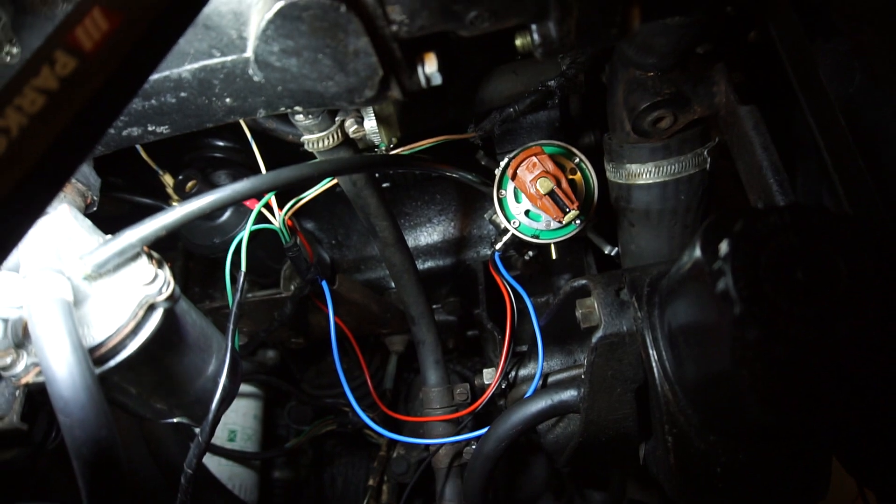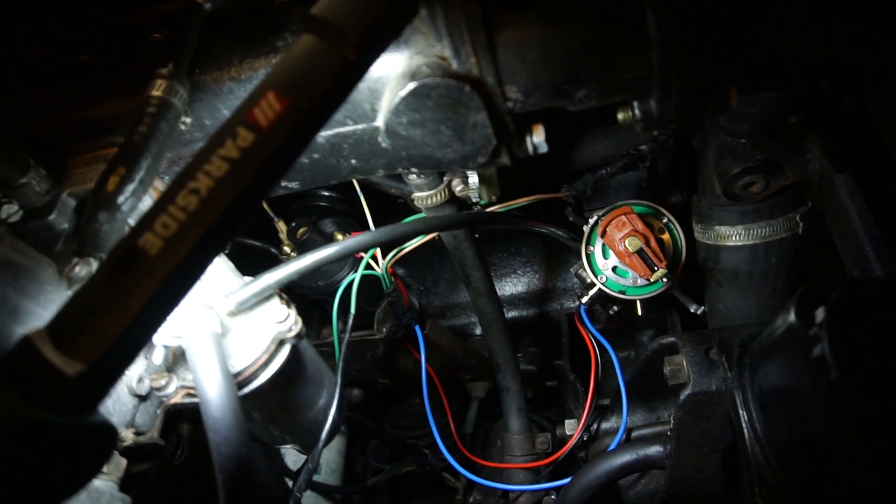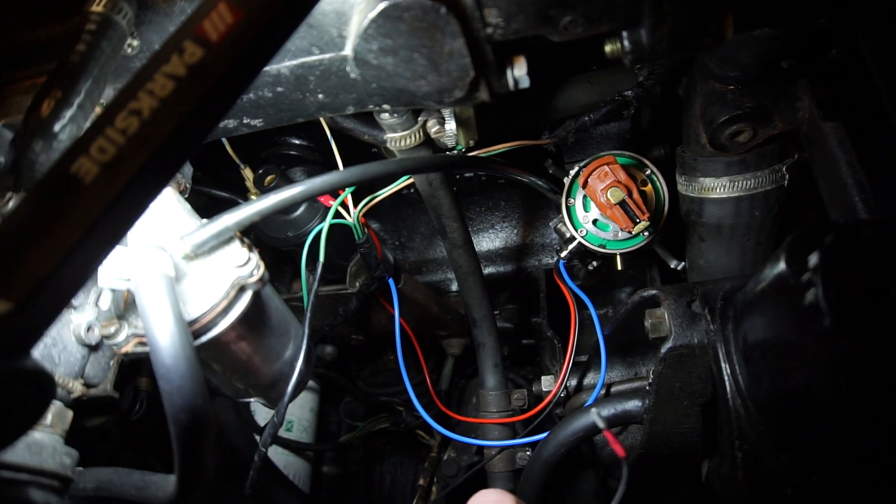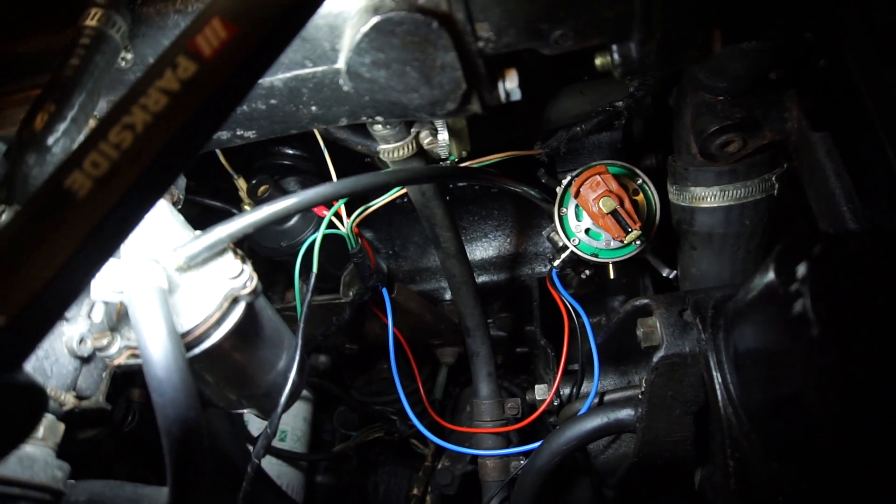It comes with a lot of cables, so that's really good. I've kept them a little bit on the long side just because maybe I'll put this in another car at some point. It comes with a really good little manual, and on the back there's a wiring diagram. Black goes to the negative of the coil, red goes to positive, and blue goes to chassis ground. I chose to put my chassis ground down here connected to the engine. You're supposed to connect everything besides the black cable, because now it's time to set up the distributor.